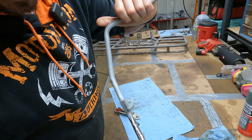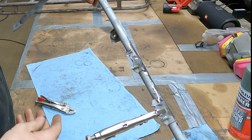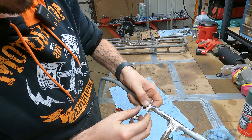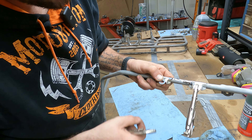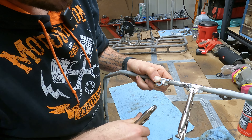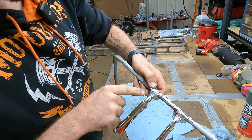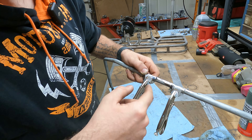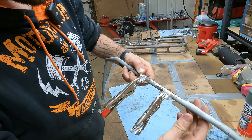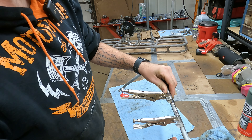We got it cleaned up halfway decent — I think it's good enough. So this tab right here was originally to hold the fenders on, so I just need something I can stick a bolt through. I'm going to take a washer and just kind of line it up — you can just see the last little bit of radius where the original hole was. I'll line that up with it, stick it on there with vice grips, put a tack weld on each one, then take the vice grips off and weld it a little more solid. There's not a whole lot of weight on this, so I think a washer is going to hold fine.